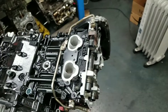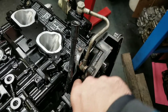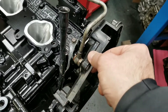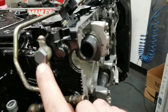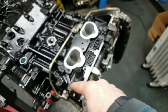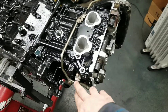Let's talk real quick about where to find these nasty little buggers. The first one is right here — on your US cars that have the screens on the AVCS on the passenger side, the outlet from the block is where you're looking. It'd be nice if that was the one that had it, but it's not — it's the one behind the timing cover, which you basically can't do anything about while the timing cover's on, meaning it's a pain in the butt. The next place we find one is right here — this one's pretty easy to do in the car. This is a modified line, but this one right here also has the screen. This one feeds the AVCS and the turbo. Some other cars that didn't have AVCS, that just had a banjo coming off here to the turbo, also had the screen in them.